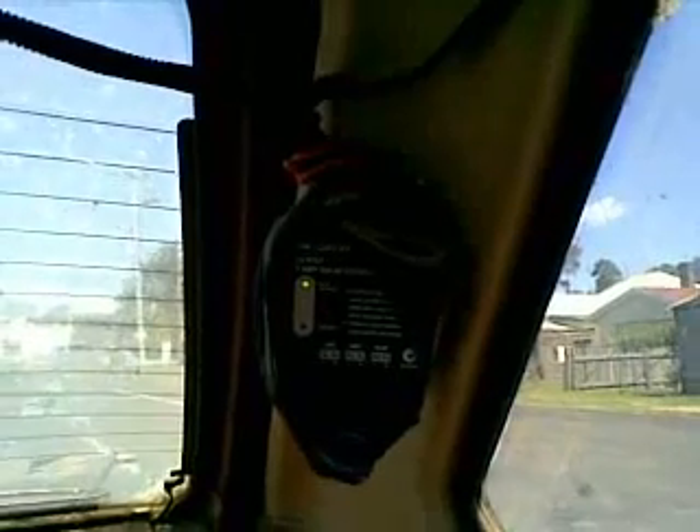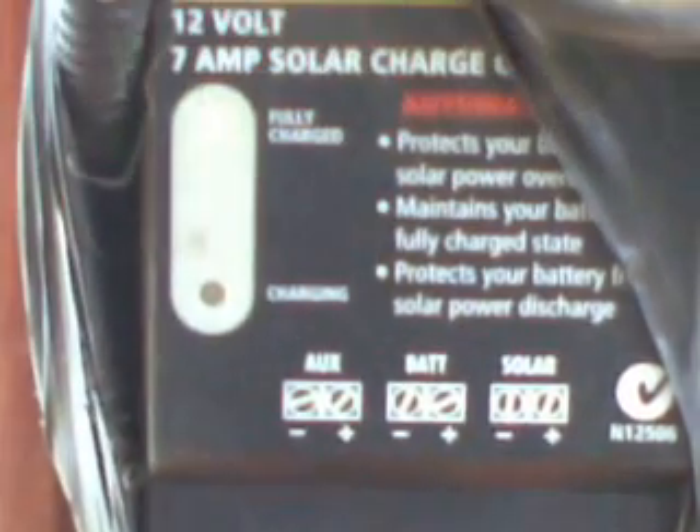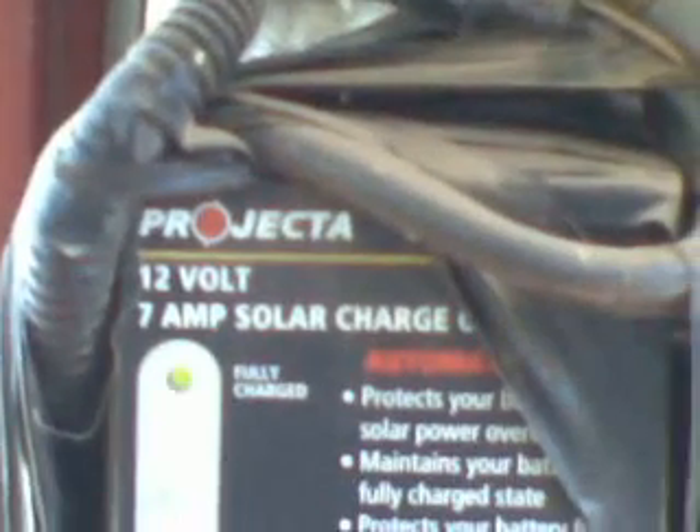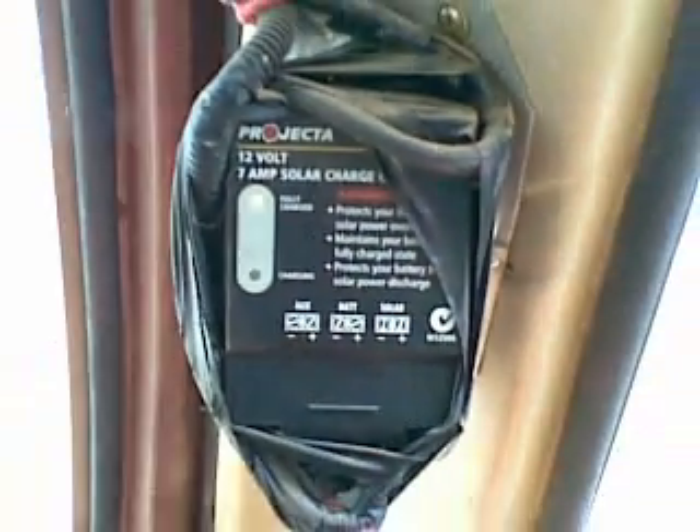There are points of potential vulnerability where the wire could become damaged. A video's been put up by Dave in Canberra, who's got a 20-watt panel on the roof of his Ford Explorer with exactly the same charge controller as we've got here. What happened to him was he lent his car to his kids. The wires from the battery became disconnected at the terminal posts — I've got mine all strapped up with electrician's tape — but Dave's came adrift. Happily for him, it was while he was driving that the wires cross-connected and let all the magic smoke out.